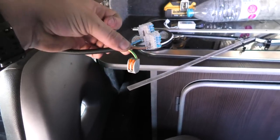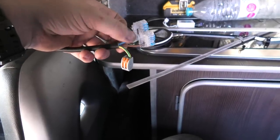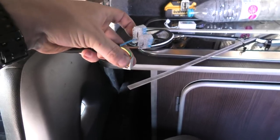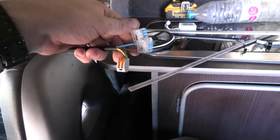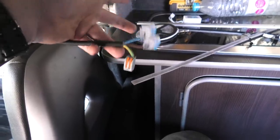So this will go up into that little cupboard, and we'll just connect the USB charging point into here, pos and neg. Obviously this is fuse and switch back at the panel, and then we'll connect that straight through to the switch that does them mood lights, whatever you want to call them. And then eventually we'll do another switch off this pos and neg that'll then go to a little nightlight for her, because she likes to have a nightlight on. So what I've done is I've rewired everything, got the charging point in, rewired the switch panel, put that all back together and moved a few cables.